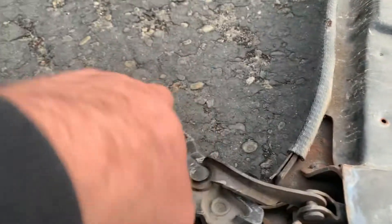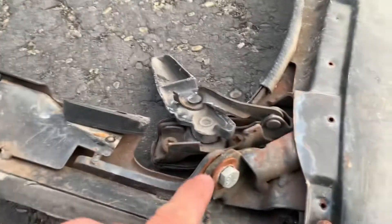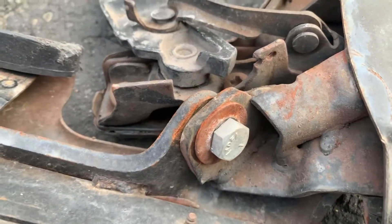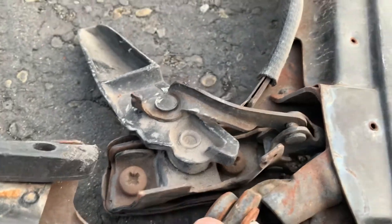The second bow ball joint brackets — looks like they got bent somehow, so those are going to have to be replaced. We already have replacements for those, new in the bag. We're also going to need a brand new bushing kit. I'm going to go back with the original hardware; it looks like someone put in grade five hardware and this doesn't even have the nut on there, so that's something I'll be addressing.